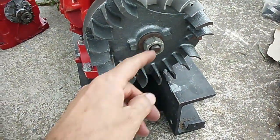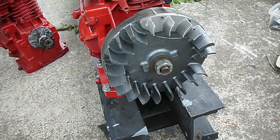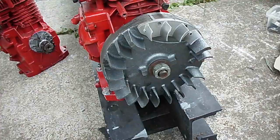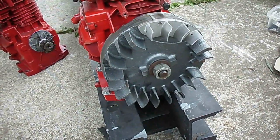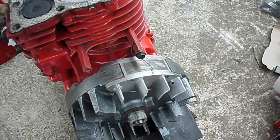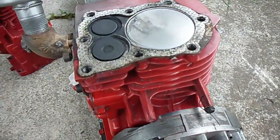The first thing I did was re-tighten the flywheel nut on cylinder number one. Turns out it had a sheared flywheel key in it from its last run on the five-cylinder. So I've got that all straightened out now, and I've got my top dead center mark there on the flywheel. And the piston is indeed at top dead center.